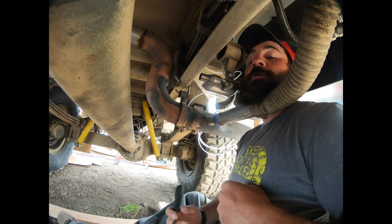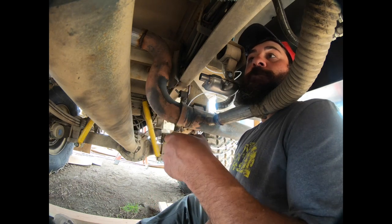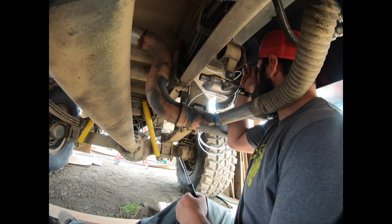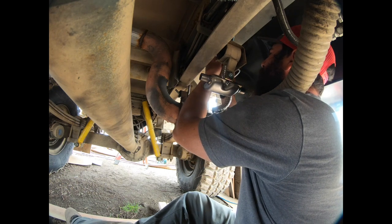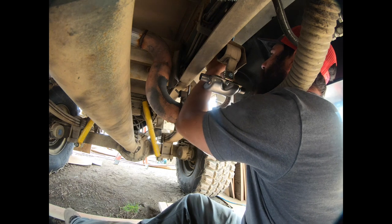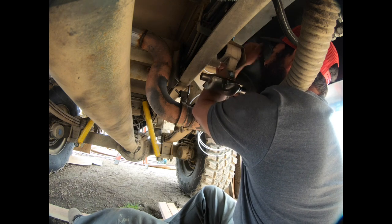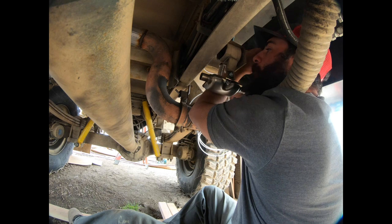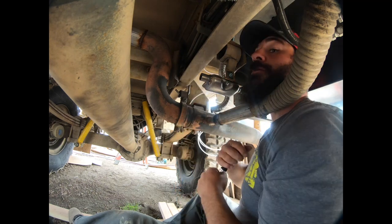I'm going to use this hose clamp and go ahead and hose clamp the insulating jacket onto the exhaust so it doesn't slide down. I'm putting this right over top of the jacket that we slid on before we dropped the heater in, and now I'm just tightening down that hose clamp. This hose clamp is going to hold the jacket so it doesn't fall and pull away from that air intake — because that's what we're trying to protect, the air intake.